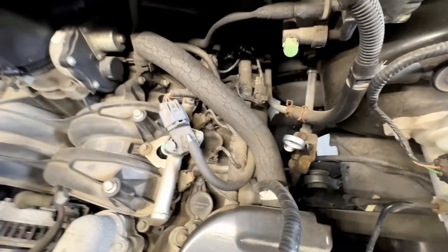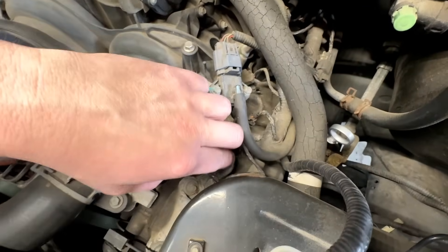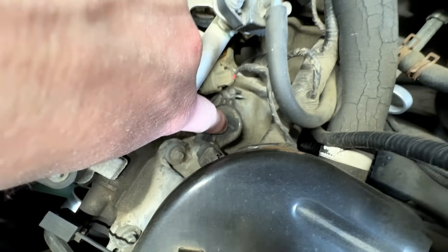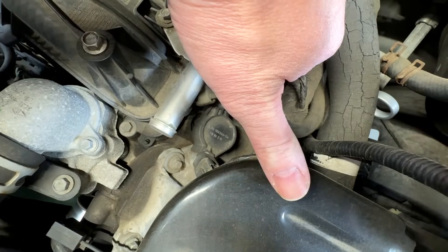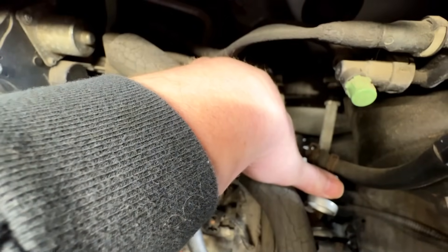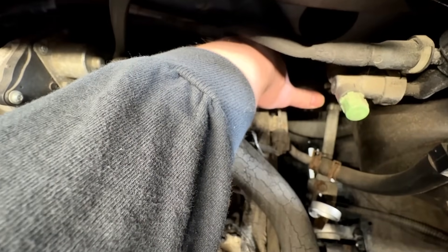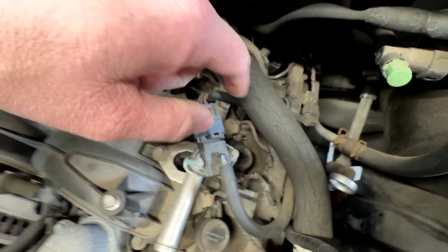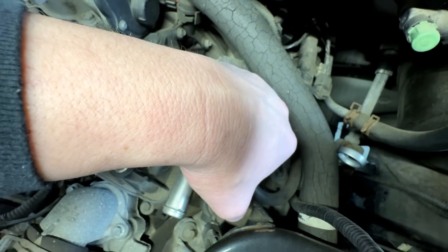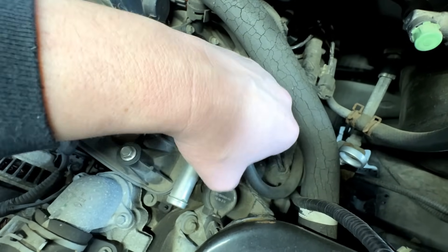On this side I'll stick my head right over and let the exhaust gases come up if they're leaking out the spark plugs. It smells pretty good over here and it's quiet too. On this side it's a different story - strong fuel smell, almost like raw fuel gases. The next thing I do before turning it off: put my finger on top of each one of the coils and push down hard. You'll feel the pulse coming through - don't feel it on some, maybe a little bit on others.